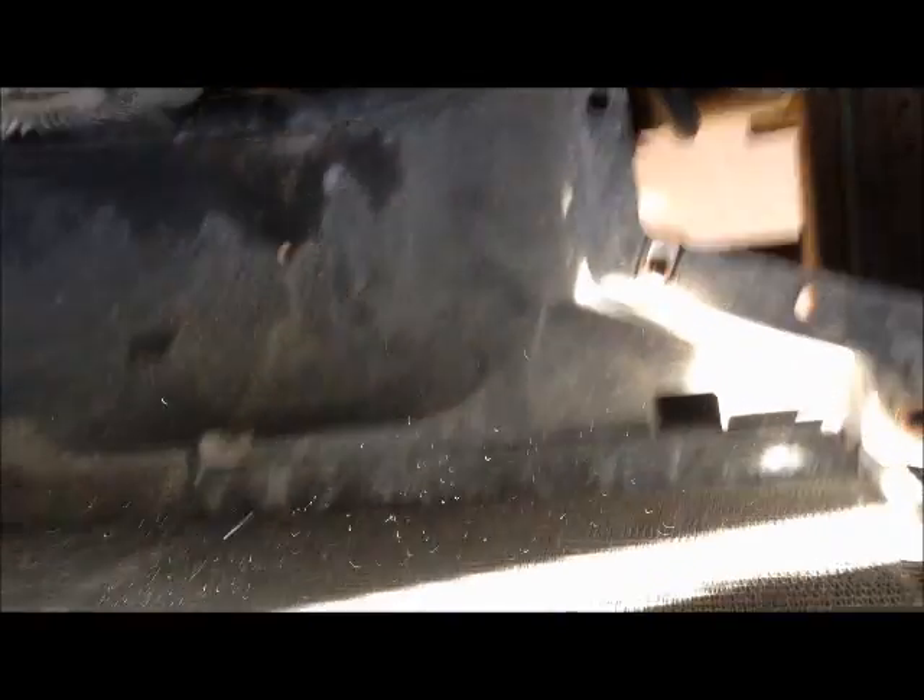That's what it looks like — the bottom piece. You can remove it as well if you like. The top piece just clips on and bolts on. The power steering pump is down below the alternator. I'm going to remove the belt and see step by step which way to go to remove it.